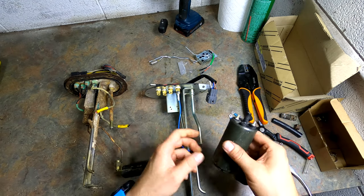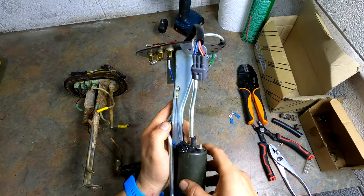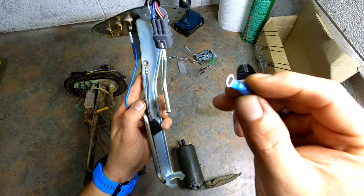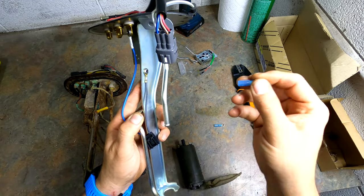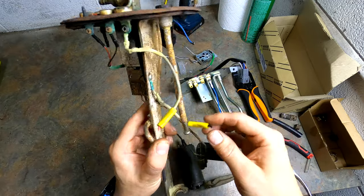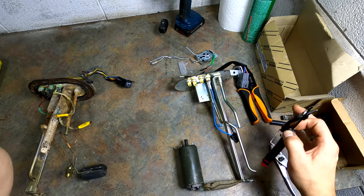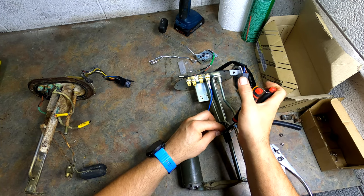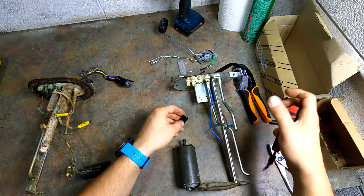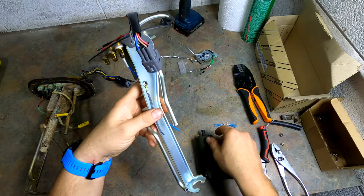This is our Toyota Denso Supra twin turbo pump — we need to get this on here and attach it with a little stub of rubber line. We have to cut the brand new connector to do eyelets on top with a crimping tool and then heat shrink over it. Past me used regular butt connectors which worked, but the crimp ones with the heat seal are better. I'm going to cut this as close to the connector as I can because I need all the length I can get.